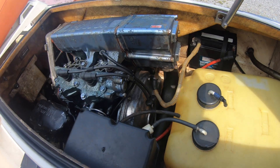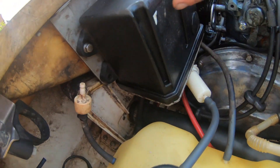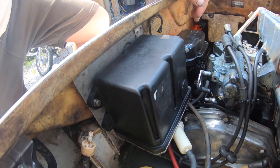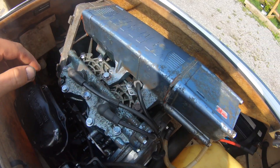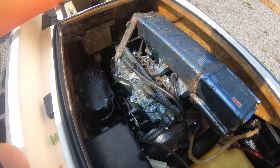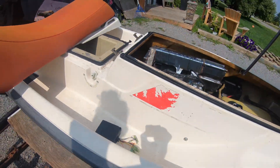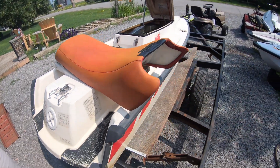We're back in the driveway. Everything went well. This was my issue — this thermo temp sensor right here. It goes into your electrical box, and what you want to do is unplug the pink wire. I covered it with a rubber boot so it's not floating in there live and grounding out or touching anything. That was my whole problem — this silly little sensor. For me, it was a pain in my butt. So that got sorted, carburetor's dialed in. I ended up taking it out two or three more times and I think I have it where I want it. The plugs look great. Fresh battery in it, and now it's time to clean it up. Thanks for watching — we'll see you soon.